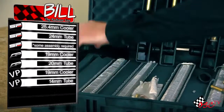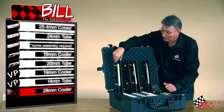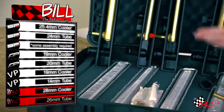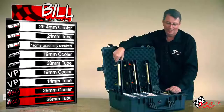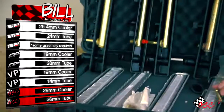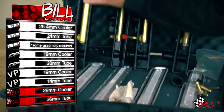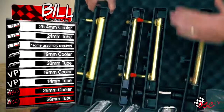When you get into the OSC unit, it has a 28 millimeter concentric cooler tube inside there — not 25, not 19, but 28 millimeter. So that's really going to cool your transmission. You also have a 26 millimeter tube compared to a 24, 20, or 14. So if you're going to Death Valley, don't worry about it. You also have a die-cut gasket. The difference between all these gaskets — oval, o-ring, or half moon — is that with a die-cut flat gasket it's touching 100% of the surface of your tank and your core itself, so you get the maximum amount of cooling.